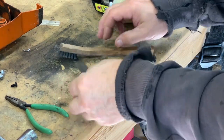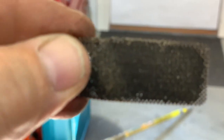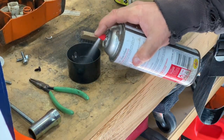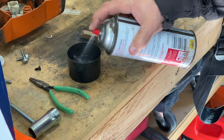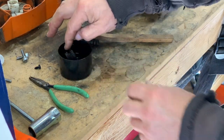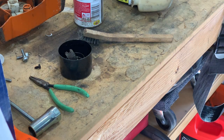It's pretty well clogged. As you can see, it's still not doing so great — still pretty clogged. So what I'm going to do is let it soak in some carburetor cleaner for a little bit and see if that helps loosen up the carbon stuck to it. Let it sit there for about 10 minutes, then scrub it again and see how it comes out.